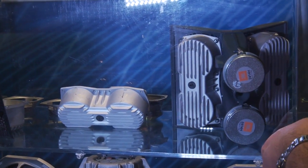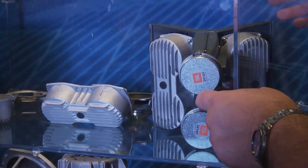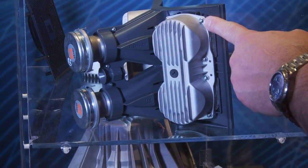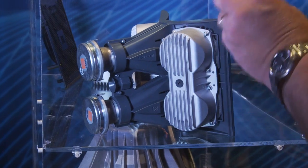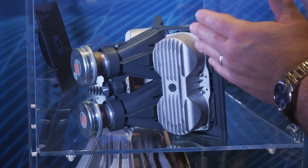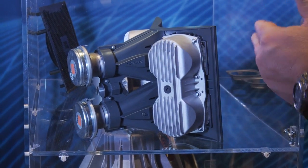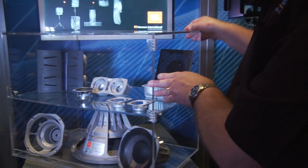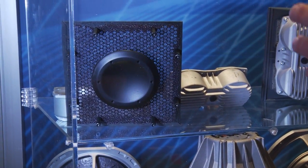You've got fins, slots for air, and the high-frequency drivers at the back. JBL has also taken care of inside horn resonances by using a special foam absorber, which helps phase response and impedance matching — so the impedance of the air and the horn are matched, giving better transmission of energy from the horn to the air. The low-frequency driver also has a phasing plug so that all sound coming out is in phase.